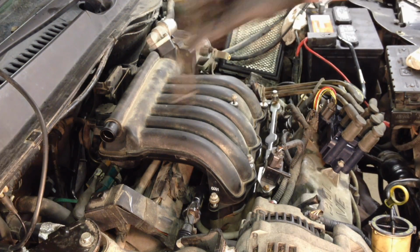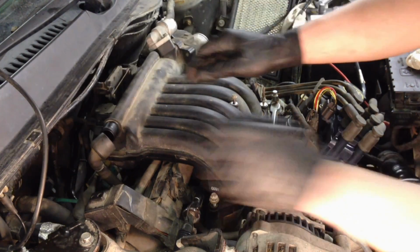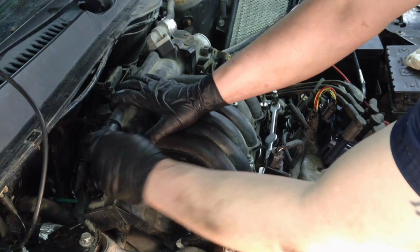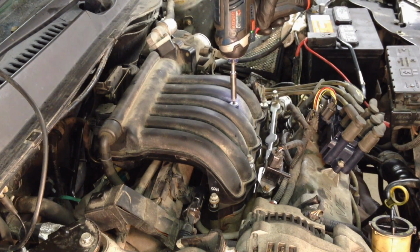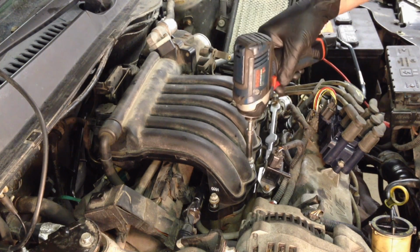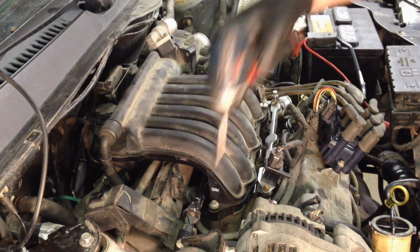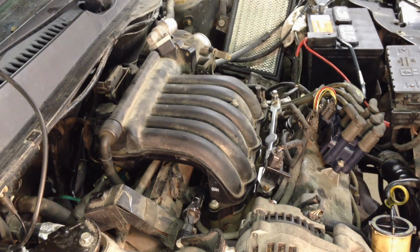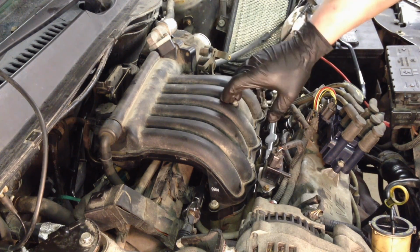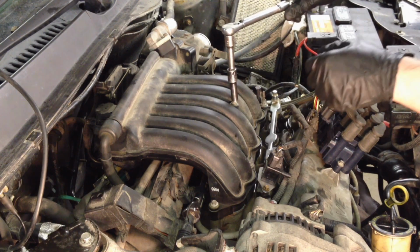Let's put our PCV tube in right now. Make sure you clean it with the brake clean on the outside, so there's no vacuum leaks. Snug these down. Make sure you get your rags out of there. They want us to tighten these down snug like I just did, and then a second stage of 89 inch-pounds.